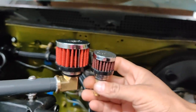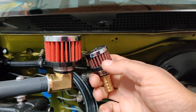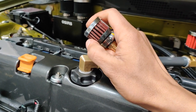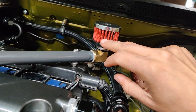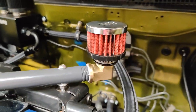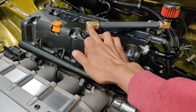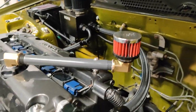Compared to this setup I had — my first setup — this filter doesn't look that much smaller on camera, but in person, let me tell you. You see how it's like red, like burgundy? That's because there's nothing but oil in here, guys. Because I had this directly on top of the oil cap where under there is oil just splashing everywhere. Yes, it was pressure getting out, but not as good as it will be now — considering oil is never going to basically get up here and just oil down the filter. Not only is the filter almost double the size, but it's not going to get wet. The liquid has to travel through here and then go up there, and by the time it gets here — this is 8 inches — so basically another inch here, another inch here — this is 10 inches full of travel that the oil would have to leak up out of the filter.